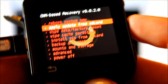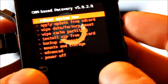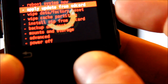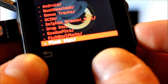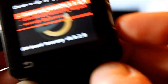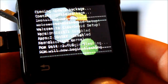In recovery mode, volume up and volume down is up and down, and the power button is Enter. After you've downloaded this ROM — the link is provided — you're going to transfer it to your Motoactive anywhere on it. Go to 'Install Zip from SD Card,' choose the zip from SD card, and browse to your zip. I've got version 1.1.2A — which is the same as 1.1.2B without the package installer. You'll probably have the latest one, so same idea. Hit Enter, go all the way down to Yes, and it installs.